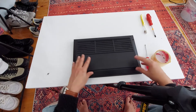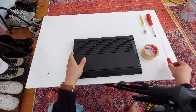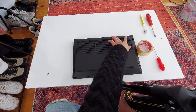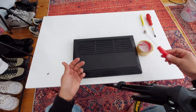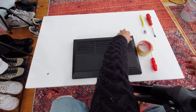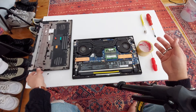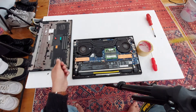Today we're going to clean the HP Omen 17 together. It's a pretty nice and powerful machine. It doesn't get that hot. There are about eight screws, all the same size — four in the front and four in the back. Once you remove the screws using a Phillips screwdriver, you start working your way around it with a bank card opening from the back and then the sides. Once you open it, you can see it's pretty dusty — I have not cleaned this for quite a while, and it's a pretty new machine.